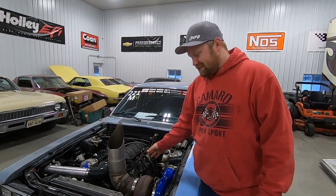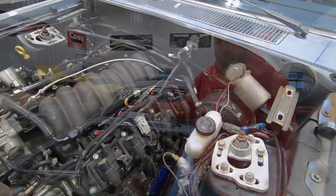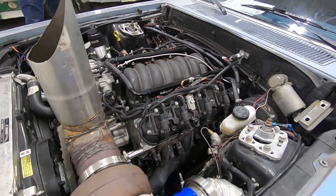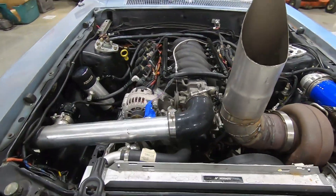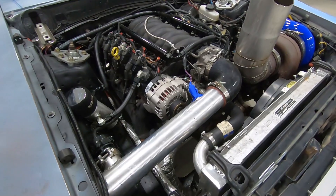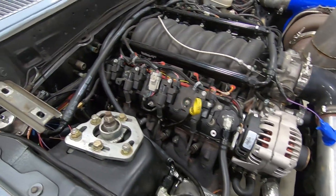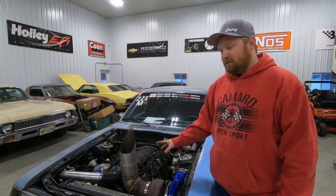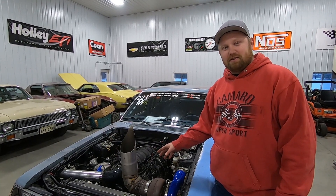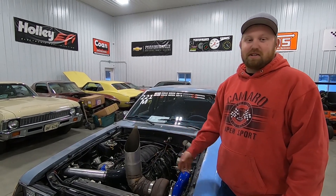The engine is a 2004, 5, or 6 — we don't exactly remember — but it's a Gen 3.5, meaning it's a 24X crankshaft but it's got Gen 4 internals. This engine was actually bought from a local salvage yard that ran good. We got it back, ripped it apart, and the engine was completely locked up. We put penetrating fluid in all the cylinders and let it sit for a weekend trying to break the thing loose.